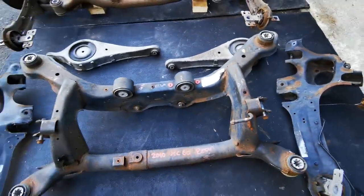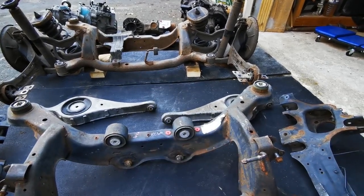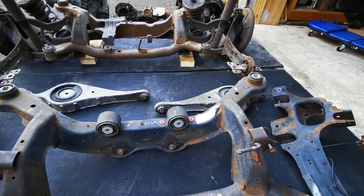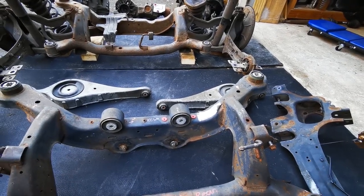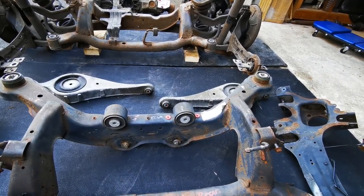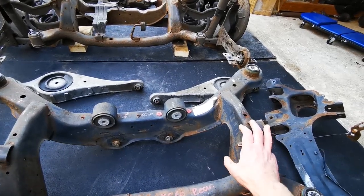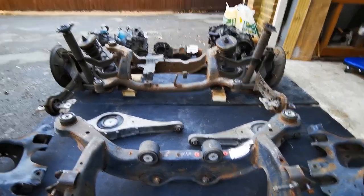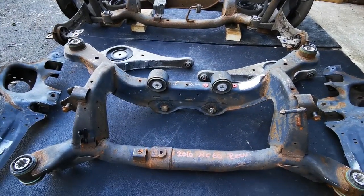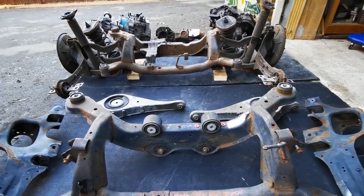There are some subtle differences I've seen — these little things that hold the rear springs in are actually aluminium on the XC60, which should save a bit of weight. Other than that, the trailing arms obviously need new trailing arm bushes but even those look exactly the same. I thought maybe there would be a bit more bracketry or something, but no — it's literally exactly the same. So I think we are in business. We're going to have to do some interesting stuff with the exhaust hangers, get rid of a lot of the surface rust, give it a rub down and a paint, and figure out that evaporation tank bracketry. But this is really, really promising — after a bit of a clean up I think this is all going to go in without much hassle.